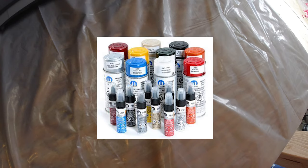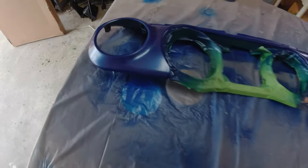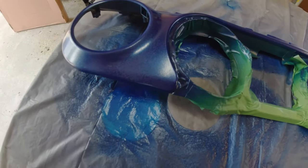Another critical error on my part: these small six-ounce cans of paint are sold by local dealers as paint repair kits for small scuffs and chips — that should have been my first clue this was not the right product. My second clue was just how thin the paint was on my test spray. I would not recommend using these kits. The paint was very thin and the solvents they used were super strong — strong enough to actually dissolve the primer even after 24 hours of cure time, marring the color with gray and making me add more layers of paint.